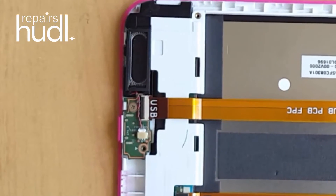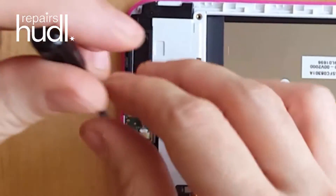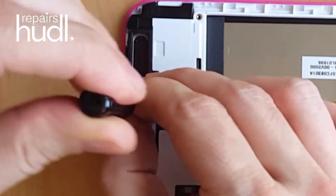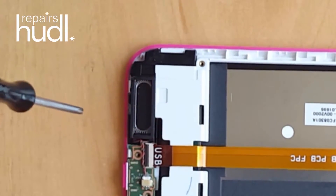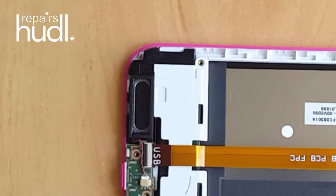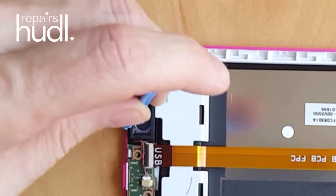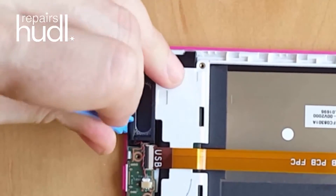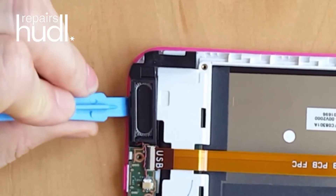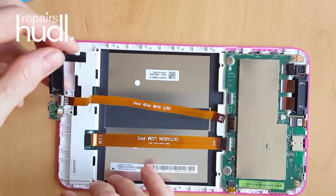As you can see, the second Phillips head screw is now visible. Once this is out, it's time to use a spudger tool to prise the speaker out. These are held in place with pleasantly weak adhesive — enough will remain on the speaker for you to stick it into the new case. Lift the charging board, speaker and ribbon cable out in one piece.